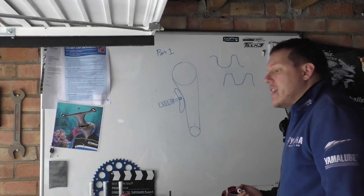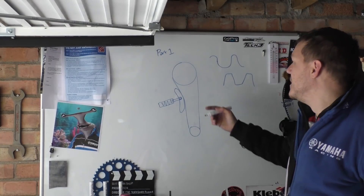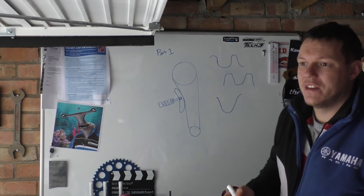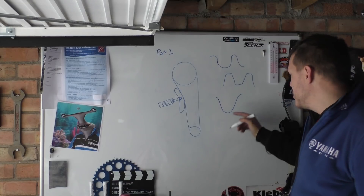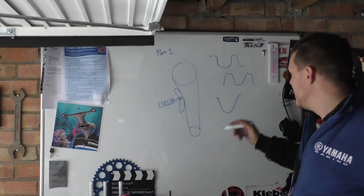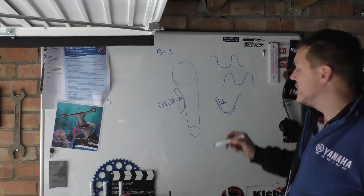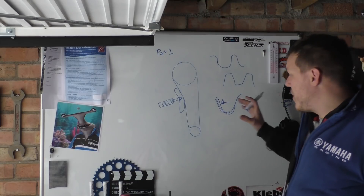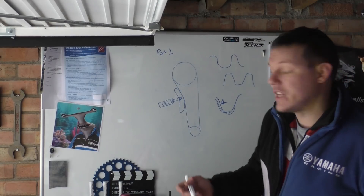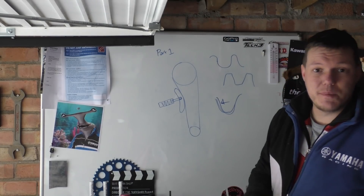You need a tensioner because over time the sprocket is going to wear. Involute chain teeth generally tend to wear less, but as the chain wears — because it's under tension — it starts to wallow out. There's wear, usually on one flank because the force is applied in one direction. Because the chain can wear, rock, and move, you could possibly slip a tooth and go out of timing. A cam chain tensioner applies tension to keep the chain at the correct tension so you don't skip a tooth.